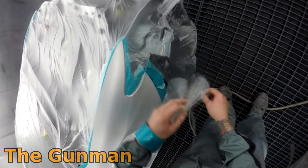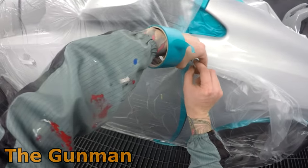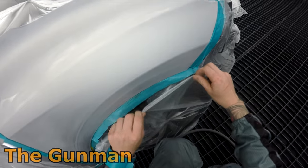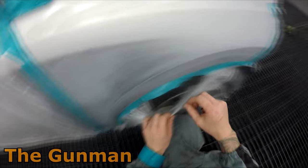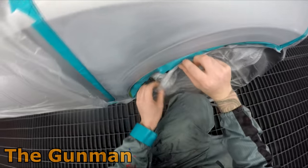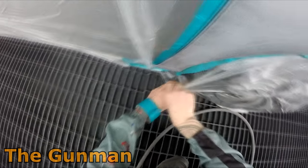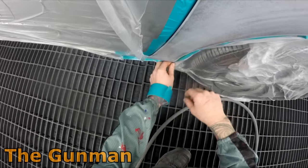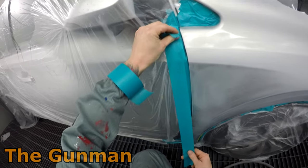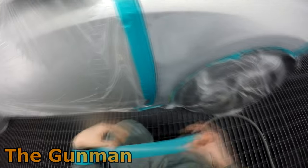You can use paper, but I've found these days in Australia no one really uses paper anymore. I find this plastic is a far superior method. The plastic these days has a coating on one side, so make sure you get it the right way up. Don't laugh — I've seen experienced tradesmen get it wrong. The plastic was up the wrong way and everything was going fine until I got to the clear coat, because the higher pressure caused it to flake off all that base coat and land back in my job — made a big mess.